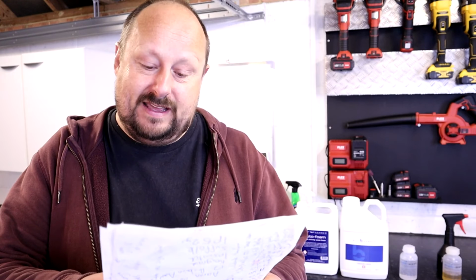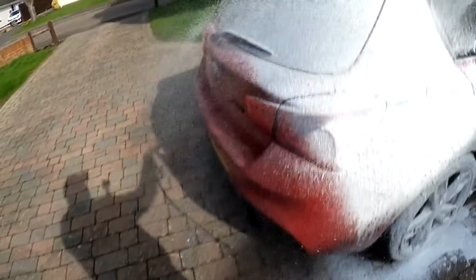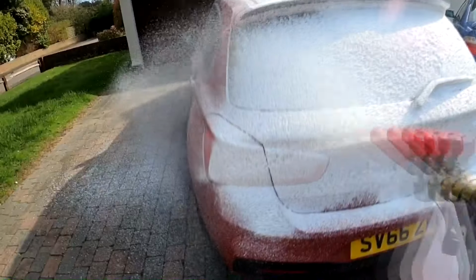The use of pre-wash is absolutely vital, where the aim is to preserve a defect-free finish. Love that, because I've been saying that for a while on the channel. I think it's more important to get dirt off during pre-washing than it is to worry about how many buckets you have. I think pre-washing is more important. If you can shift off 95% of the dirt, imagine if you're not shifting that 95% and you're going straight in and contacting on it. It's just logic, isn't it? It's basic logic. The use of an LSP to add protection on the paint system helps to disguise any minor imperfections.